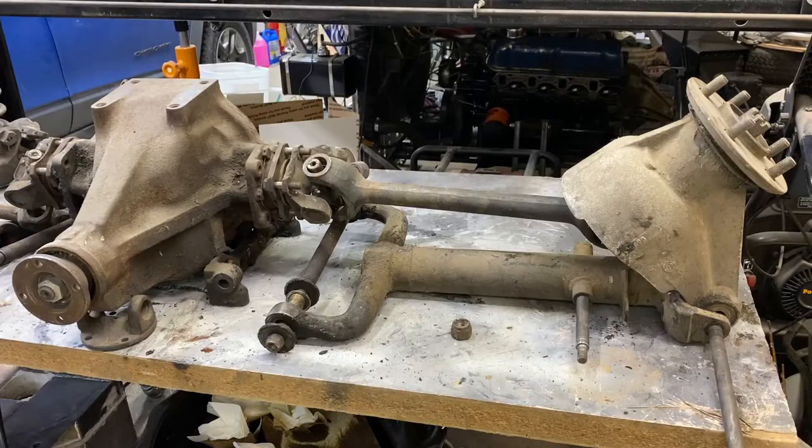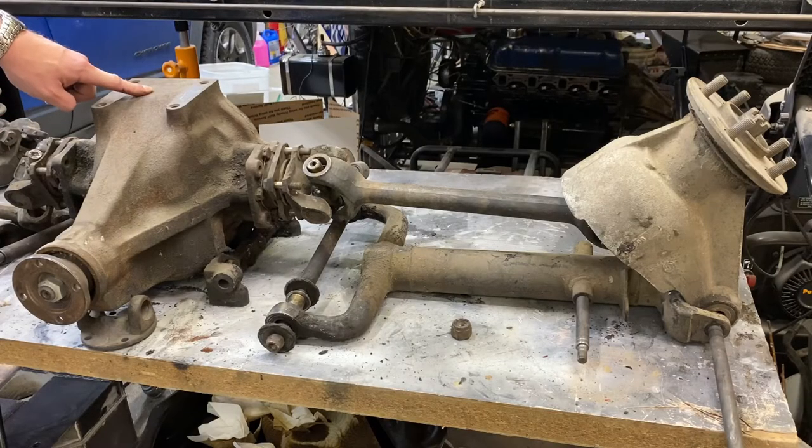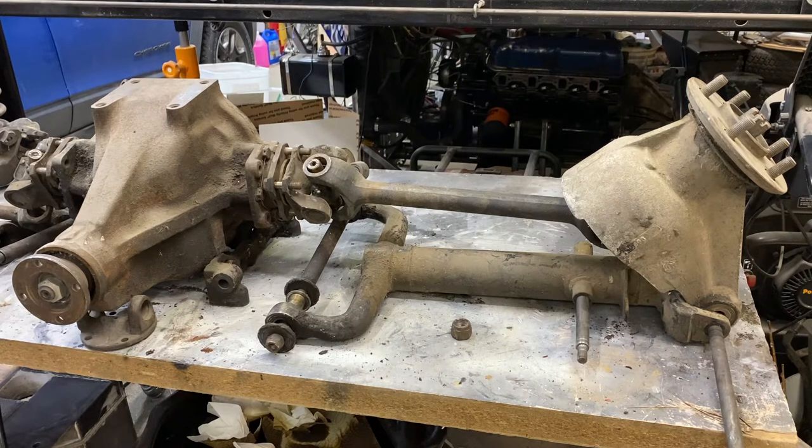So the first thing we have on this assembly is the Salisbury Differential. A lot of people think that if they go with a Jaguar, it's going to be foreign and parts are going to be hard to find. The nice thing about a Salisbury Differential is, for all intents and purposes, it's basically a Dana 44. Other than having to use some odd bearings, you can put Dana 44 ring gear, pinion gear, and carriers inside this unit. So really, it's a Dana 44 — parts are easy to get, and the foreign aspect is not an issue.